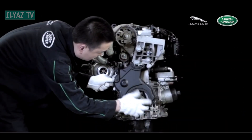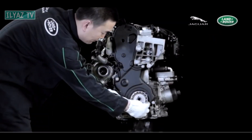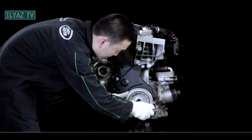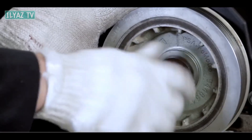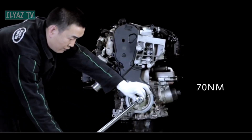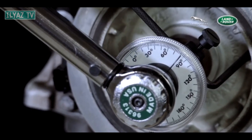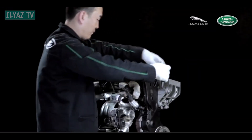Next, remove all special tools, install accessories, and install the chain cover. Install the magnetic ring and the crankshaft position sensor. Make sure that the flywheel clamps JLR-303-1272 are installed in place. Secure the crankshaft pulley bolt — be careful to use new bolts. At the first stage, the mounting torque is 70 Nm; at the second stage, an additional angle of 82 degrees is added. Install the valve covers and related accessories. Remove the flywheel lock JLR-303-1272. The timing belt replacement procedure has been completed.